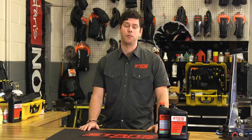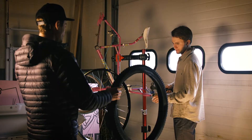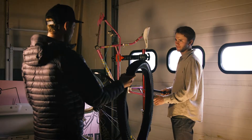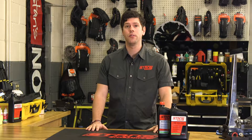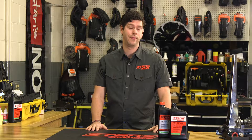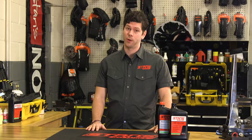Now, let's talk about a few misconceptions regarding sealant. Let's start with an easy one. I don't know which one of you is out there spreading rumors. Dude, never gonna work. Our sealant works fine in tubes and tubular tires — yes, even latex tubes. As long as your tube or tire has a removable valve core, you can add sealant to it. And hey, adding a little sealant is way easier than peeling off a tire and gluing on a new one, right?